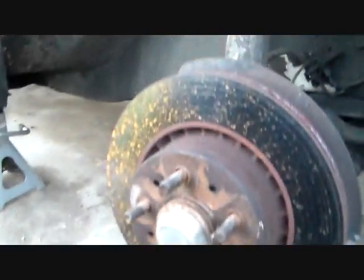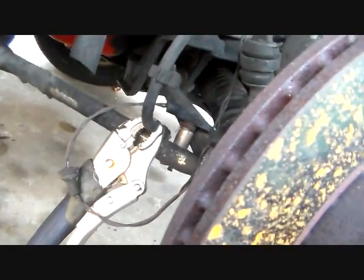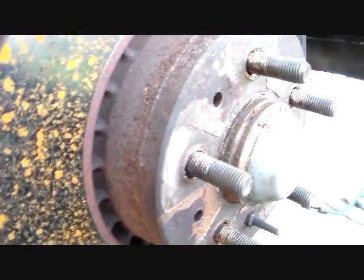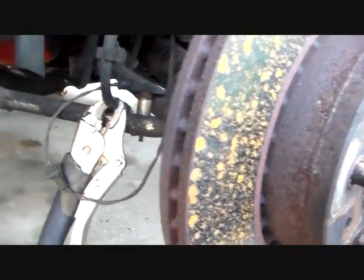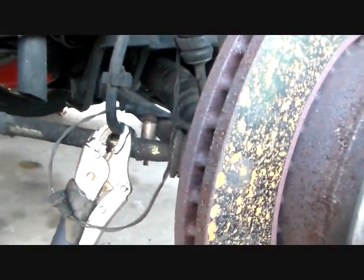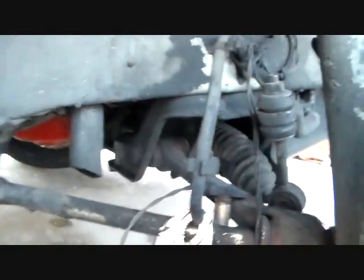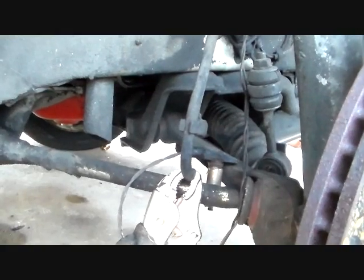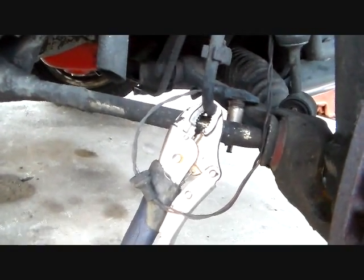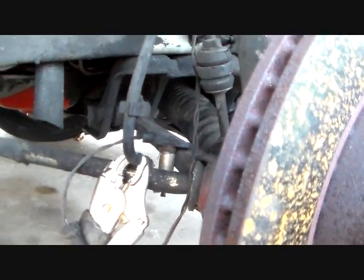And then I guess tomorrow I'll work on the brakes. Don't forget, when you put the brakes back together, now you may not have your brakes apart, but I did because I had to take this apart to turn in a core. So that's my deal. But normally you won't have to deal with that, probably. You just lay your caliper and line everything over to the side. But if you want to go ahead and clean that ABS sensor, which I'm going to do myself, it'd be a good time to.